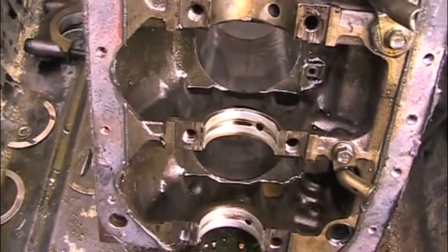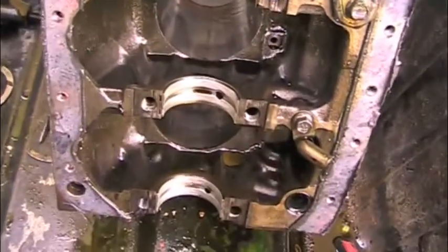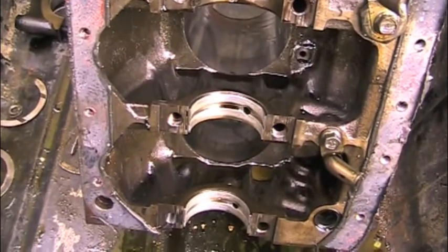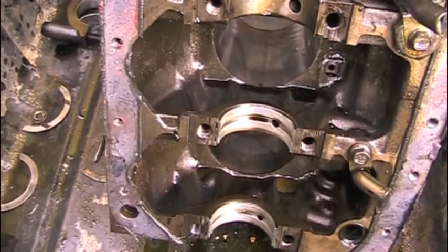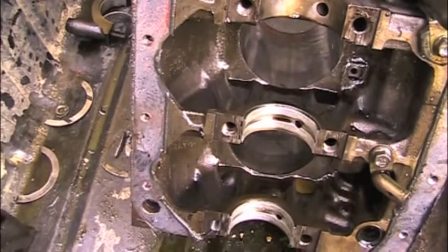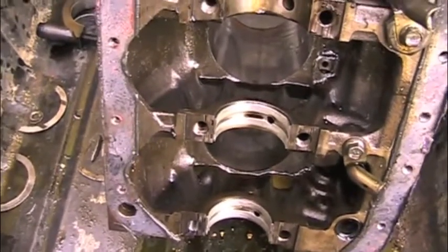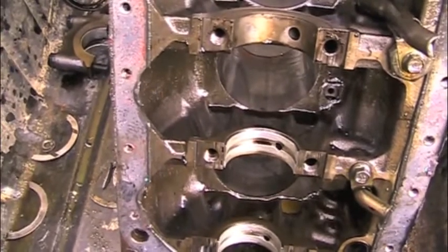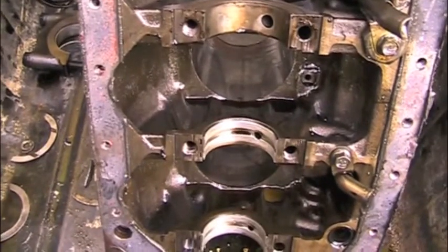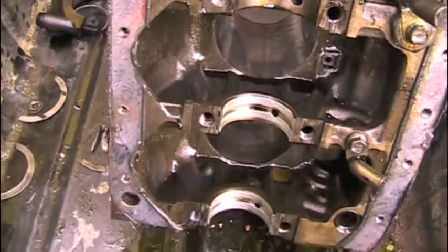I wish I had a motor I could start up and run so you could hear it — it has a distinct sound when this condition is occurring. Typically what you hear is like a low pitch rattle on deceleration, or just about peak — like if you're revving the motor up, it revs up fine and then right as you kind of let off the gas you'll hear it, kind of down inside of the motor. I apologize for the sound effects — I don't have a real motor I can start up and run with this condition right at the moment.